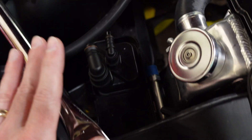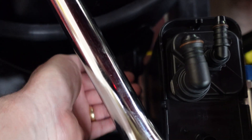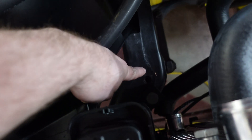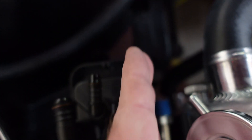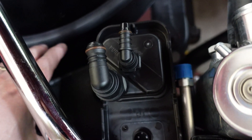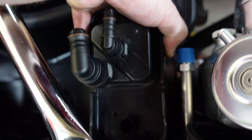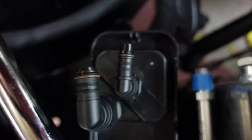We're back up to the front of the car now. So if the canister is right here, the hood will close — so this could work. We'll have to fabricate some kind of bracket to hold it in place here. I was looking at somebody else's car — they have a bracket from the subframe to the bumper right through that hole in the subframe right there. I don't remember my car having those. So if anybody knows if the '77s have that bar or not, or if that's some option. We're going to go with this for the moment. The other option is putting it in sideways. This is fine here except for the AC line right there, so I might have to finagle it around a little bit.